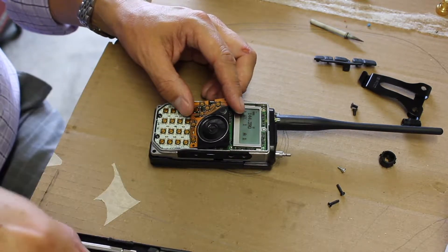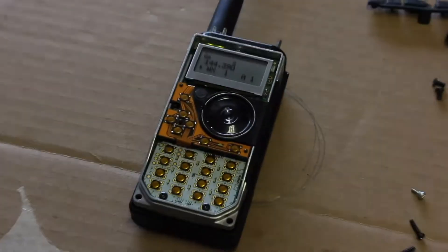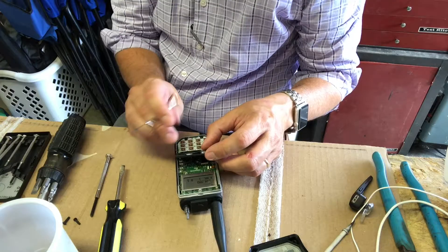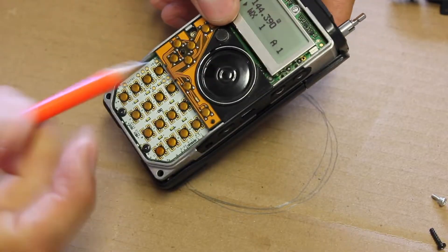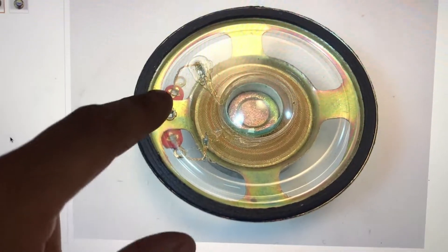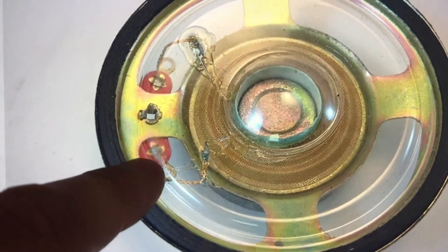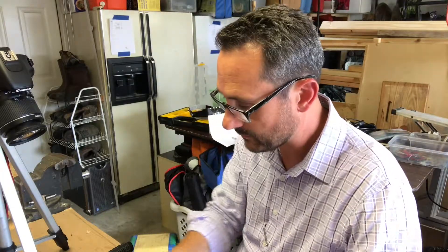I did find that if you carefully push at different places on the speaker, this is very interesting — if I push in different areas, the speaker begins to work. Those broken wires are approximately here and here. There are little cables that come up and out that connect to the coil. On a clear one you can see it — it's this bottom connector wire that is probably frayed, because earlier when I was pushing on this, that part would work. So now it's a matter of putting the new one in, which I'll get a little bit later.